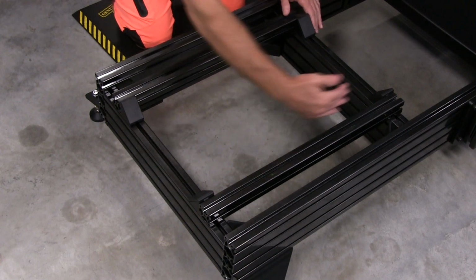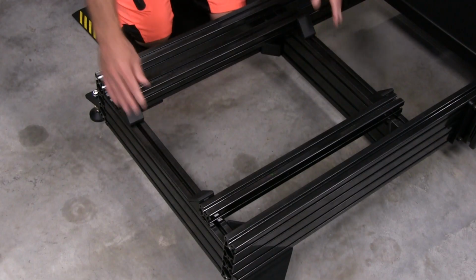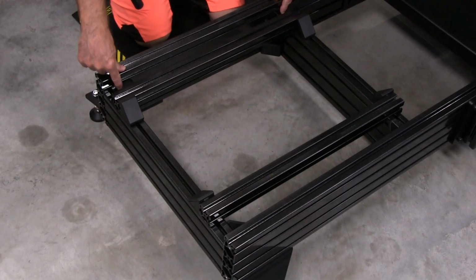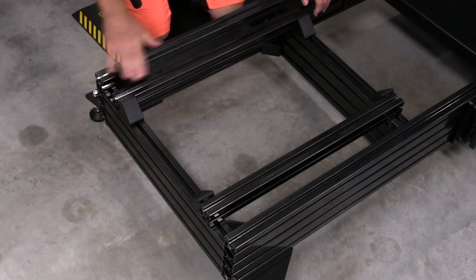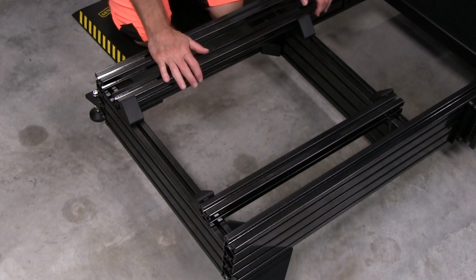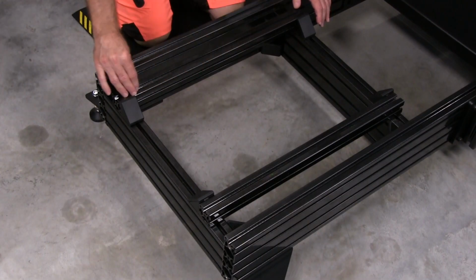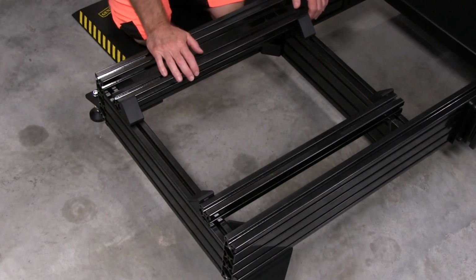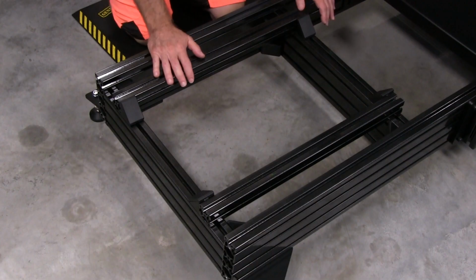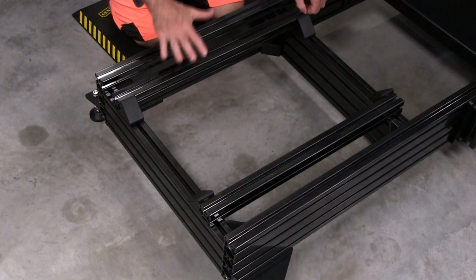So now we've turned the seat rails this way because now we have obviously a support we can put it on, but we've dropped it down below 1.5 inches. So now we've lowered the seating position when we're going to put our seat bracket on here and then attach our seat. Obviously, we're going to be sitting 1.5 inches lower right from the start. Unless you put some sliders in here, and that's going to maybe give you another 3/4 of an inch or so of height, depending on the sliders you buy. So I like the way that they've done this.